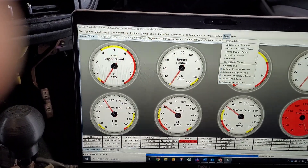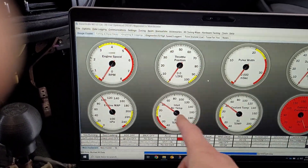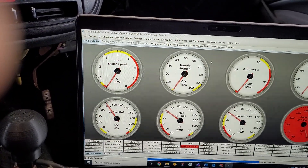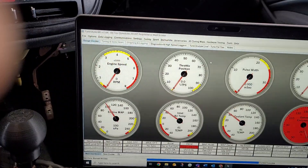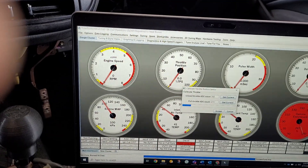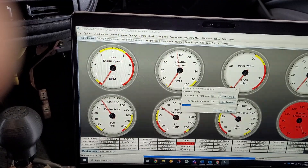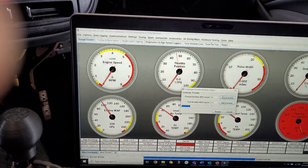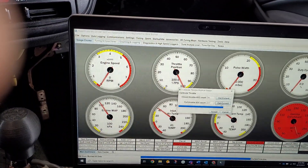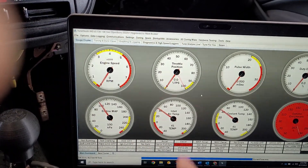If things look crazy in the dashboard, you can calibrate them. For TPS calibration: with it at zero, hit 'Get Current' to set the zero percent TPS, then give it full throttle and set the TPS to establish the full range. For pressure sensors, the standard Honda MAP sensors are scaled to read 100 kPa at regular atmospheric pressure and up to 181 kPa — about 10 psi. The J-Series uses the same MAP sensor scaling as the K-Series.